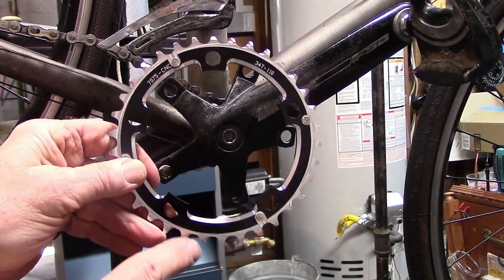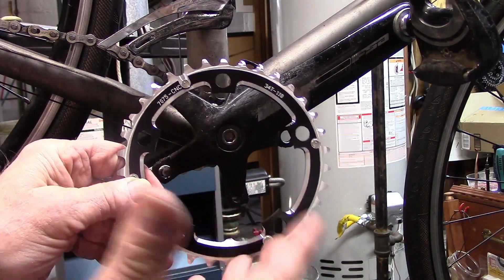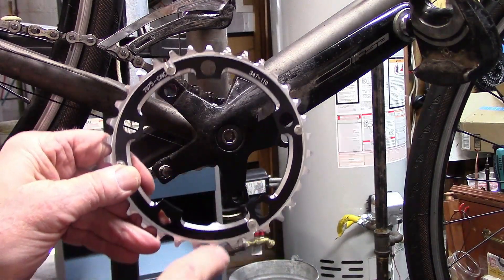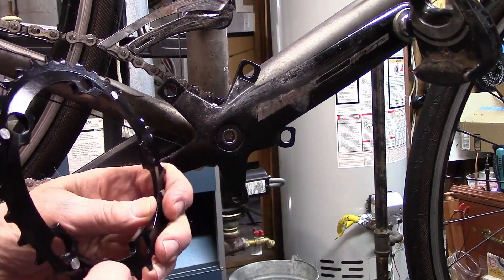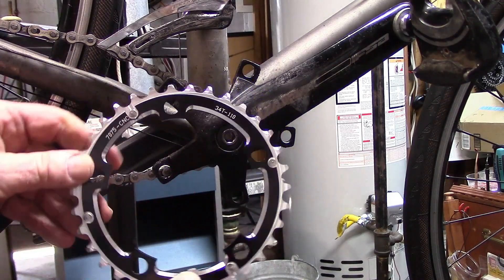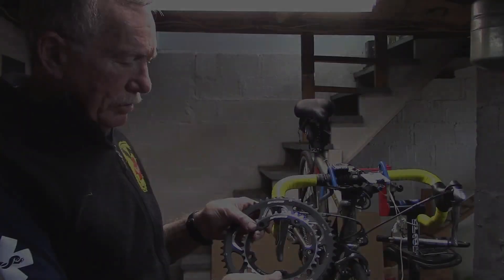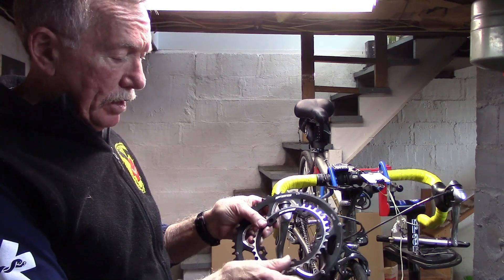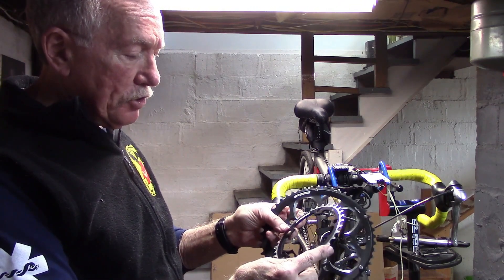With a small chain ring, usually the ring side is on the outside and faces out, except for Shimano where it faces in. You'll often see either a notch or, on the inside, a small mark that will line up with the crank. Chain rings should be matched — that is, they should come from the same company and should be lined up with the notch under the crank.